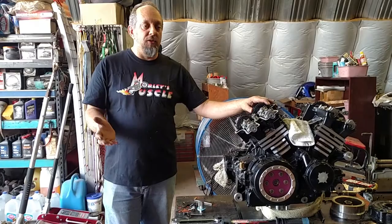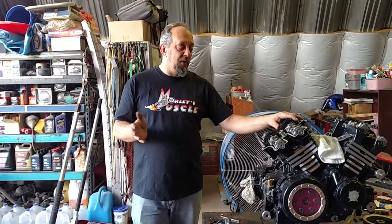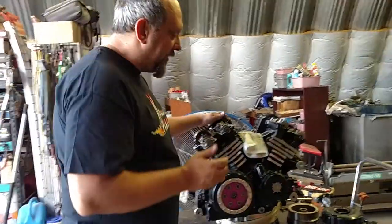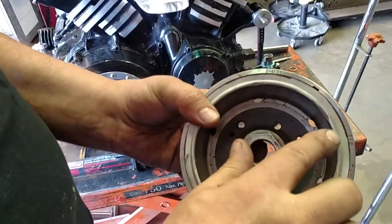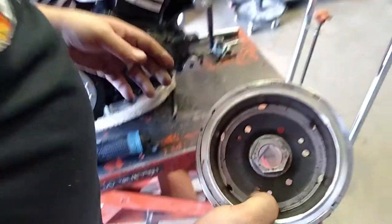First thing you're going to do is get your motor set on T1. It doesn't matter at this point if it's an exhaust stroke T1 or intake stroke T1, because you haven't set the correlation of your camshafts to the block. So first thing, just set your block up on T1. Now when I discuss T1, I'm discussing these marks here. You've got a T1 mark and you have a T2 mark, and these are what we use to set the heads with.